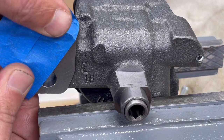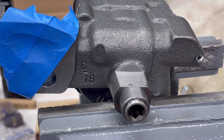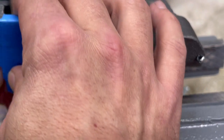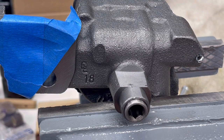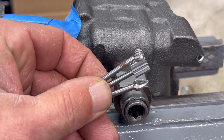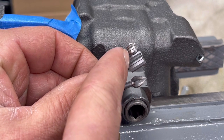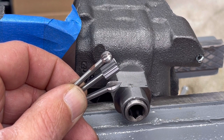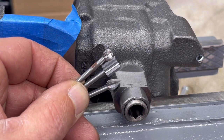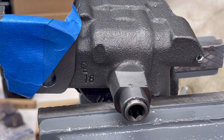You can take the oil pump apart and clean it, which we'll probably do anyway, but I'm just taking a precautionary measure to make sure we don't get anything in there. One good thing about these pumps is they are easy to take apart. John's got a Dremel tool and he's going to be doing the work. I have some different little bits here — nothing crazy. These are for a Dremel: you got one that's round, you got more of a flat one, and then you got one that's pointed. We'll probably start off with this one first and work our way into that area just to get it clearanced. Just a little bit of time — check it each time, make sure you clean off any metal filings, and make sure nothing got in there. Metal filings in an oil pump is no bueno.